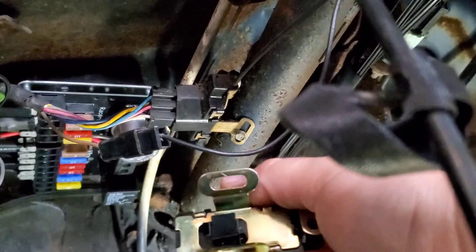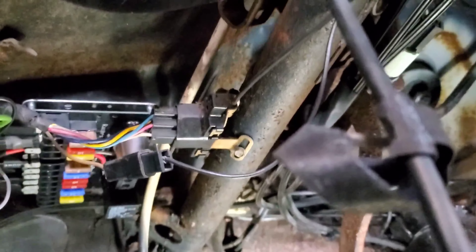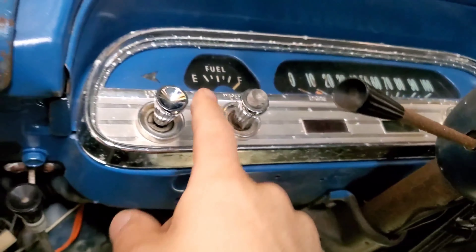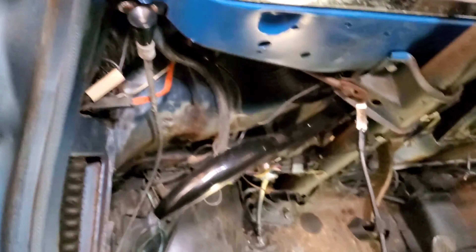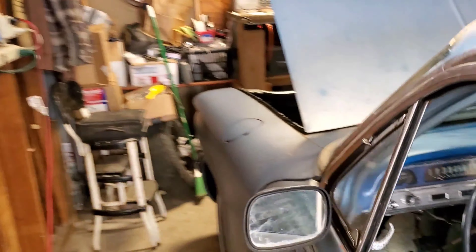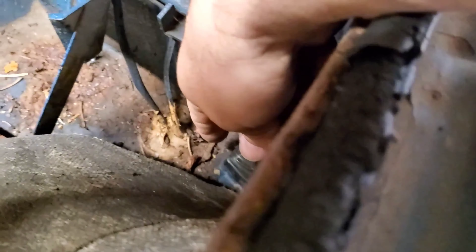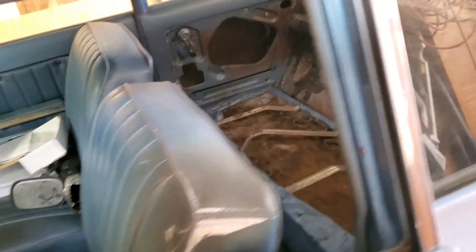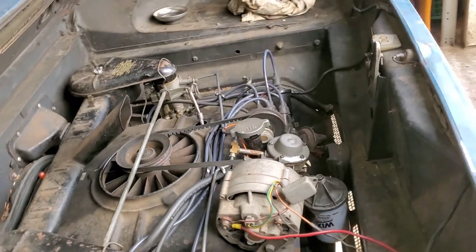Here's actually a new one. I like to start off with real easy fixes — it's always going to be a new headlight switch, which I already replaced. We didn't have any lights to start off with. It was actually only high beams, and on the Corvair there's the high beam on/off switch. There was a connector right down in here where the main wiring for the headlights came through, so anyway I got some of that stuff fixed up.